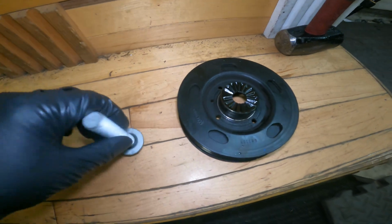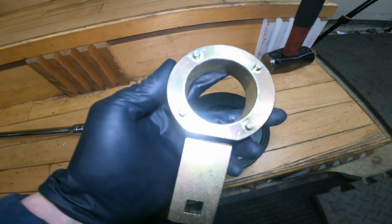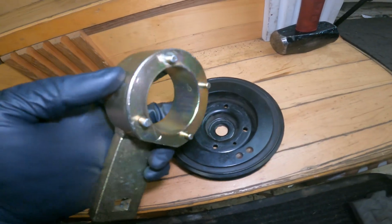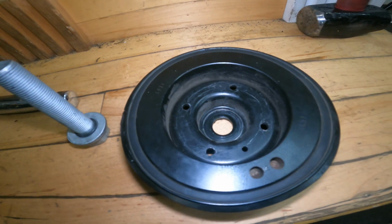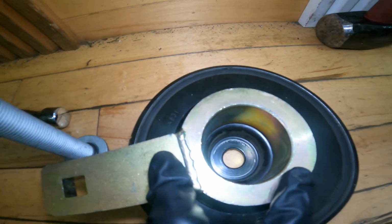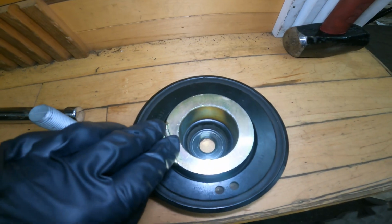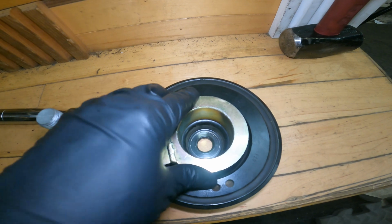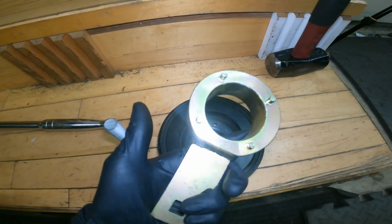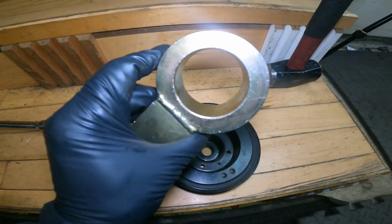All right, real quick while I've got it all out too. Here's the crank for the car. Here's the special tool that you need. So this tool, those little notches, fit right into the crank, just like that. And that's how you lock this up. Put a ratchet right here, and that's how you lock this crank up to get the right torque, because torquing this is actually a pain. And remember, there's a link in the description for this tool. This $25 tool can save you a lot of money and a lot of hassle, so definitely worth it.